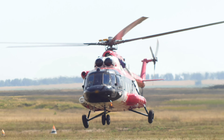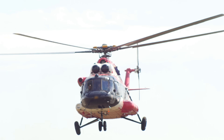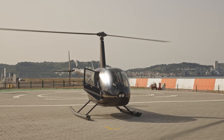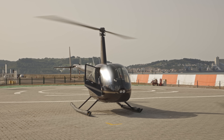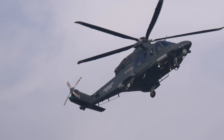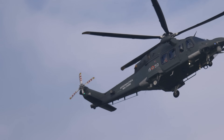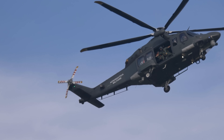And then it's got that little fan on the back too. Fun fact: the reason that's there is because a single-rotor helicopter has a big spinny thing on top which is constantly producing a twisting torque which, since the thing just floats in the air and isn't attached to anything else, would spin the body of the helicopter around real fast and make it very difficult to fly. So the tail rotor is a second sideways fan blowing in the opposite direction to keep the helicopter from spinning out of control.